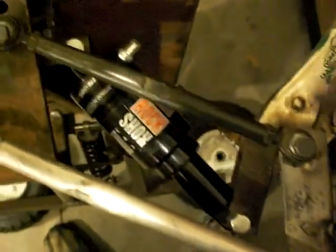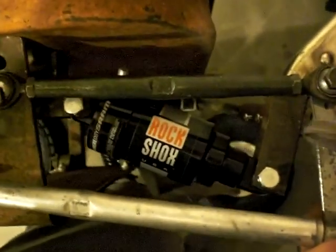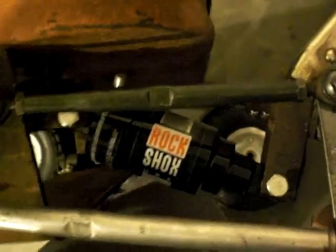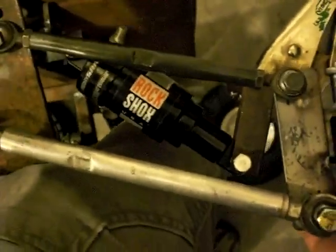You can see it's quite a bit longer and it hangs down quite a bit farther than the old bracket. It's just held on by a set of vise grips now, but as the shock travels it's no longer progressively getting softer, because when it bottoms out you can see that the shock is still being compressed. This is actually going to be around where it bottoms out now.